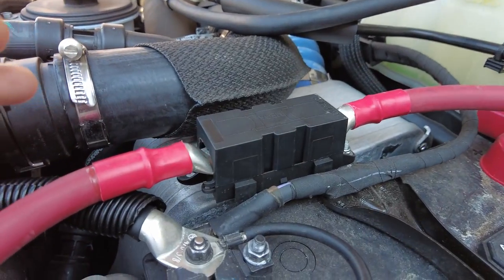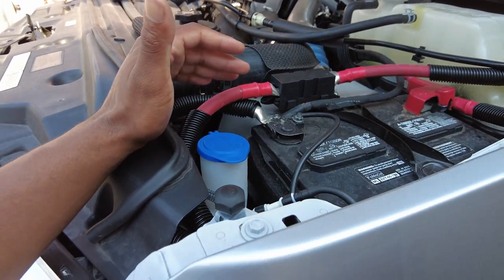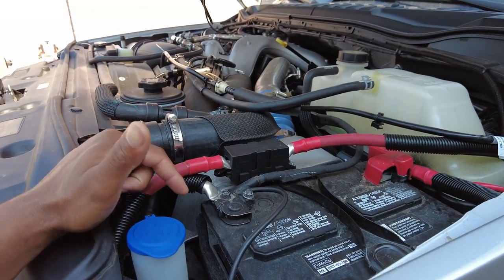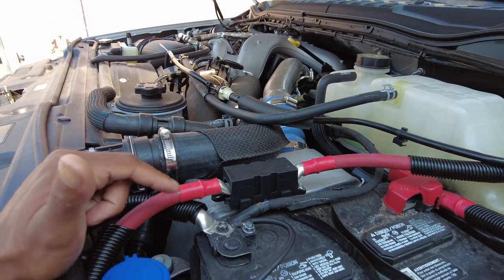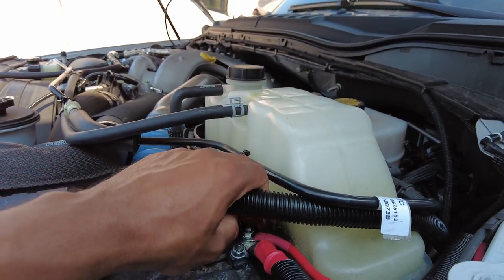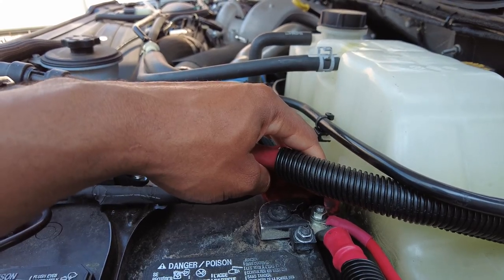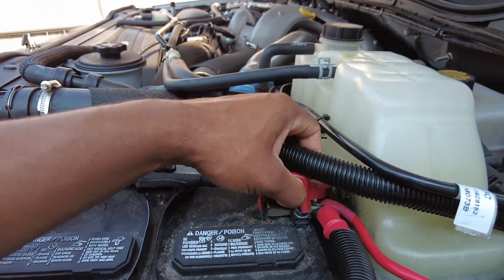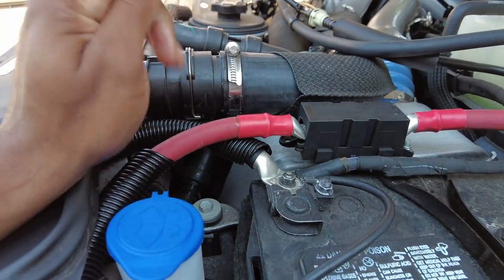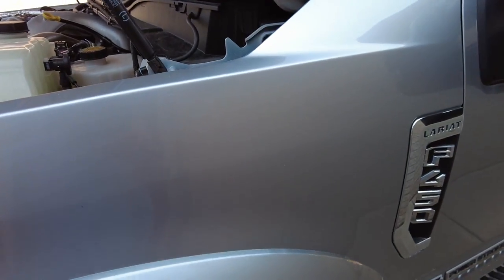The negative is hooked up and I did have to do a little bit of modification to the terminal. One of our Achilles heels running this much power is there's no great way to connect 4/0 wire to the battery. For the positive terminal I had to make a hole and put an extra bolt through it to connect to the positive lead. On the negative terminal it already had a stud there.